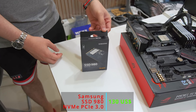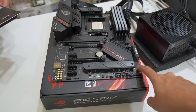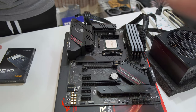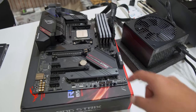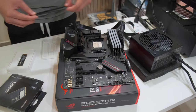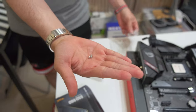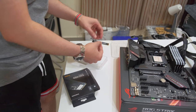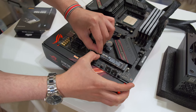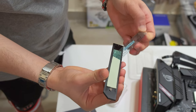Next we have the SSD — the Samsung SSD 980, not the Pro version. This is the PCIe 3.0 version, while the other slot is PCIe 4.0, which he can use later when he upgrades his drive. Right now we'll just slot it into the 3.0 slot. Take the M.2 screw from the motherboard packaging — you need one standoff and one screw. Place the standoff in the third position, then place the SSD and tighten it with the screw. Now remove the plastic protection from the thermal pad.